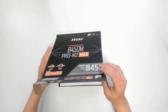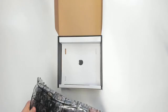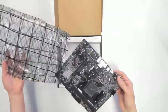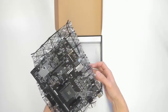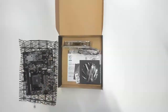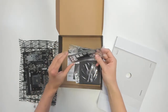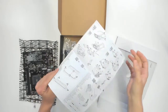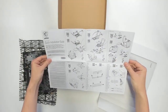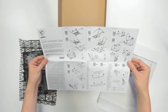Let's get this party started with the motherboard. Important: before you touch the motherboard or other computer components, ground yourself by touching a metal object connected to the ground, like a radiator. This is really important - ground yourself. There's also a metal blind we'll need later, and importantly, the manual - we're going to learn some important information from this manual later, so don't throw it away.